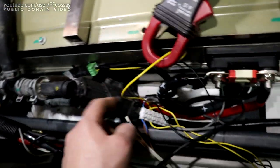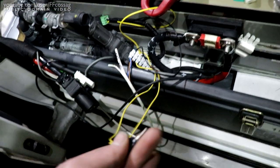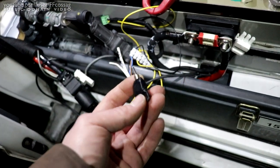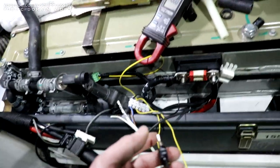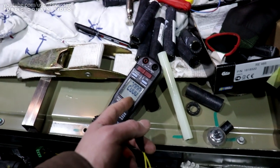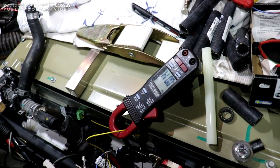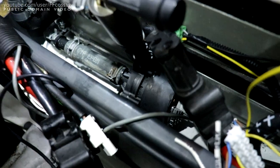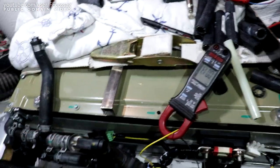The moment of truth: the expansion vessel hole is beautifully plugged, the pump controller is hooked up and plugged into the pump, and everything is connected to my contactor main switch. When we flick the switch we give 12 volts to the pump controller and the pump — it should draw about 600 milliamps for a few moments then drop down a bit. And we are circulating. Now all we need to do is burp the system and then we're done for tonight.